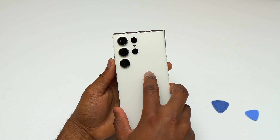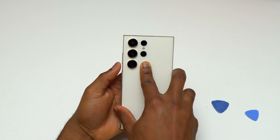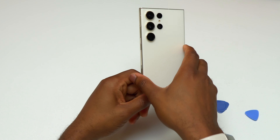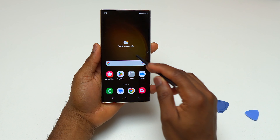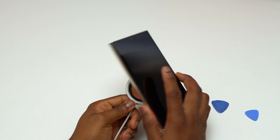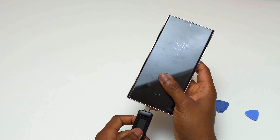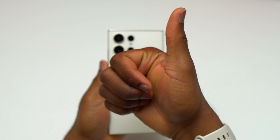For the reinstallation of the back glass, you simply need to align the back glass with the frame of the device and apply small pressure for the back glass to stick. After this step, turn the device on again and test the cameras and screen to make sure everything is working normally. Test the S Pen to make sure the screen is responding normally. Then test wireless charging and finally test charging by wire in both directions — everything seems to be working normally.